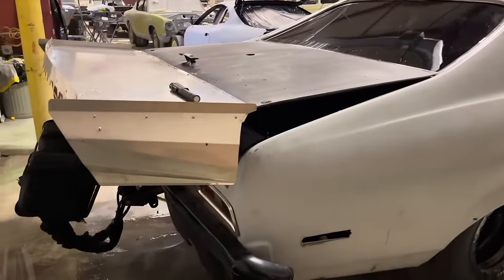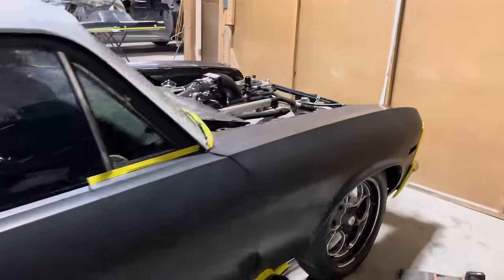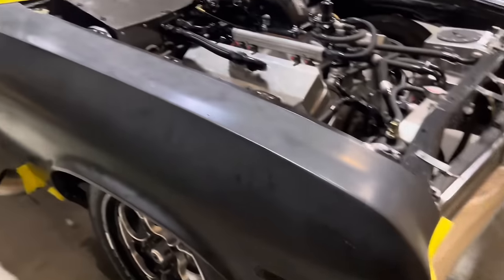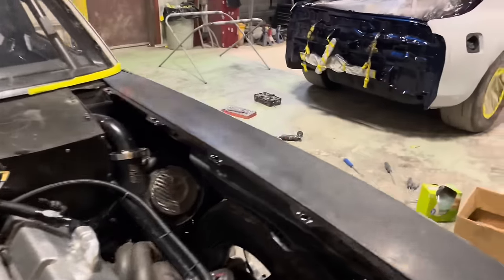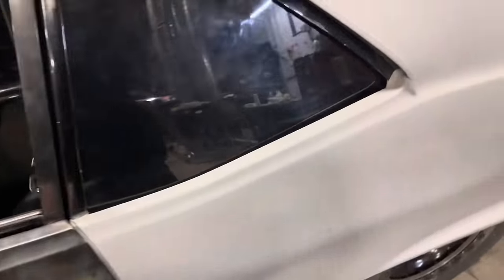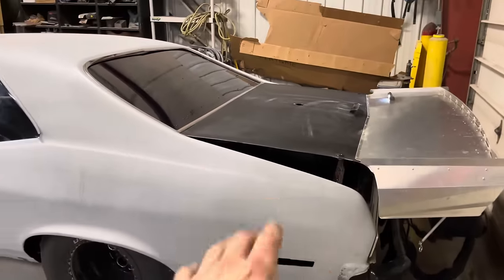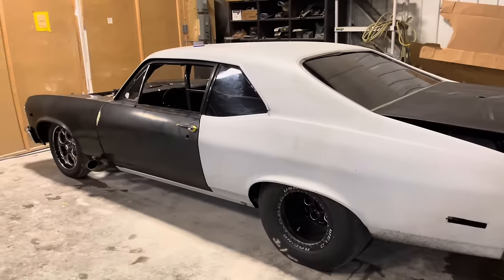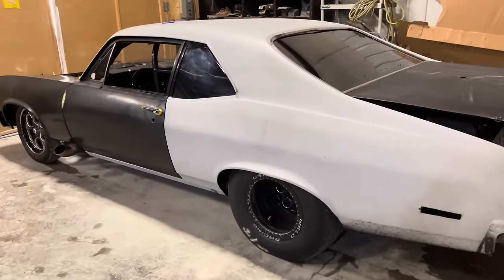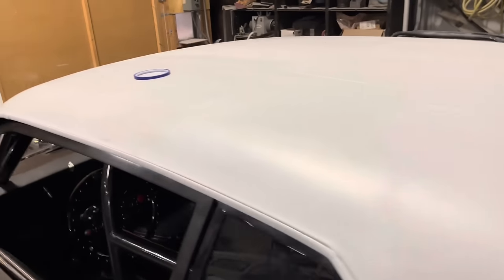So we're gonna take apart the little things that come off relatively easily. That'll make a difference. Jesse's about to drop this bumper. I'll probably pull these door handles. This I was gonna remove, but I might end up leaving it. But yeah, first step we're gonna do is sand this entire car with 320 grit, probably just on a DA.